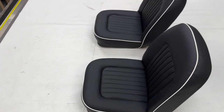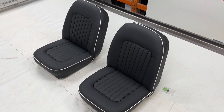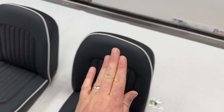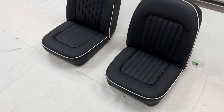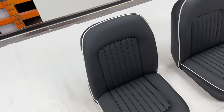So let's dive on in. A customer has sent us his seat frames and we have replaced everything — the webbings, the diaphragms. The webbings sit on the backrest and act as a spring; the diaphragms are the rubber pieces that go underneath the cushion base and also act as a spring. Then you've got the seat foams and the seat covers.